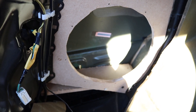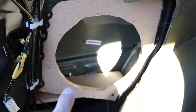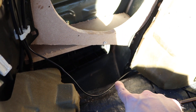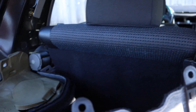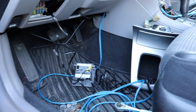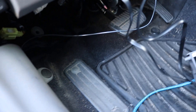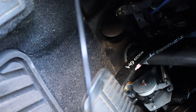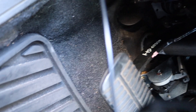Once that's cured, I can move on to the next step — but while it's curing I can also do the wiring. I've seen some people wire through the hole here, but I've already wired my backup camera through there under the seats, so I'm going to follow that same path. I'm putting my amp underneath the driver's seat so it's not too far, so I can use a larger gauge wire without spending too much. For routing the 12-volt power in the Forester, the best way I found is right up here behind the brake pedal — there's a grommet up there, just pop it out.